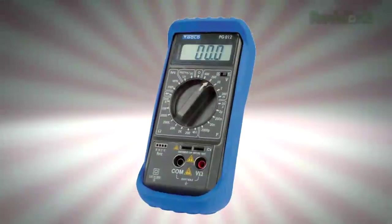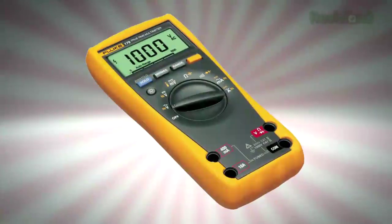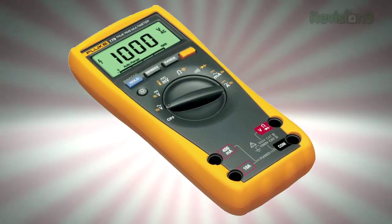We've got some geek tools for measuring that aren't as pricey as they used to be. I'm going to skip the classic volt-ohm meter or multi-meter. It's the critical geek tool used for measuring DC and AC voltage, amperage, and resistance. My Fluke is worth every penny because it can hold peak voltages when I'm testing sensors — the sensors switch from their lowest to highest voltage a few times every second, sometimes hundreds. It'll hold the peak and lowest voltage, which makes sorting out OBD2 engine errors amazingly easy.